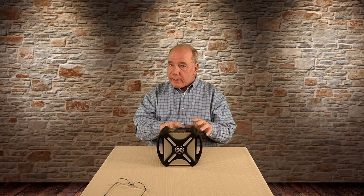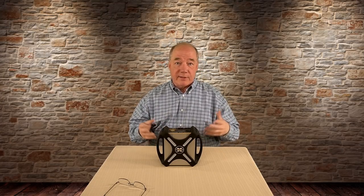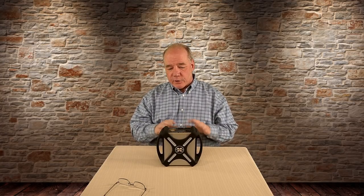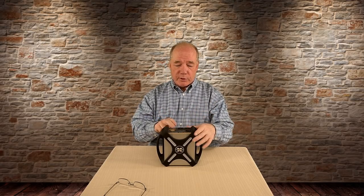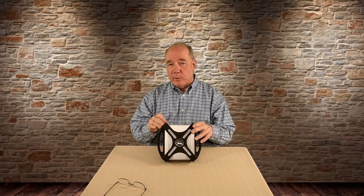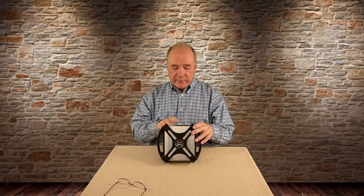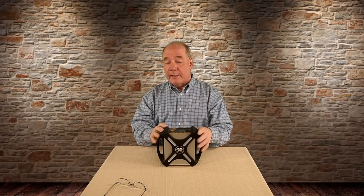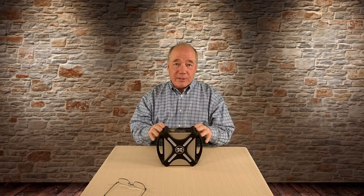Pretty much anything small works — I've used it for lamps when I was out camping, and a 75-watt spotlight worked just fine. The unit is smart enough to know that if you plug something in that's going to draw too much current, there's an LED above the outlet that will typically light up green. If you violate that by plugging in something trying to draw too much current, it'll protect you — the light will turn red, and you'll know immediately that you've crossed that line. Unplug whatever you've got and don't use this to charge it again.